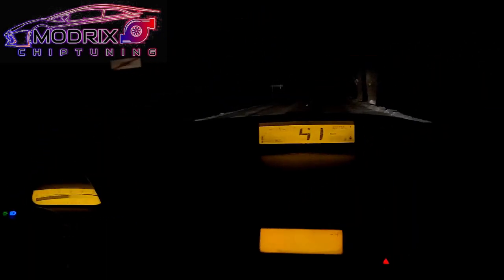Okay, let's test it — pull it out. That's very good! Nice, that's the torque curve. EGR is off and everything is just perfect. It runs good, turbo switching on from around 2000 RPM, and we had nearly 80 kilowatts on the power. That's kind of cool, all right, good.